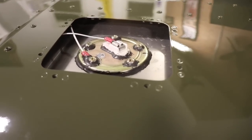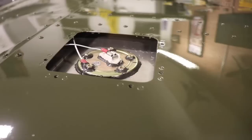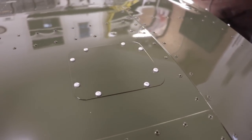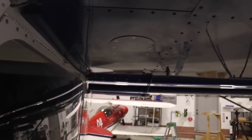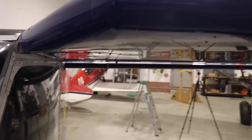Now in the Super Duty, you can see that the fuel senders do sit below the skin. So all I need to do on the Super Duty is put a flat cover over the sender. If we take a look at the right wing, this is what the cover looks like over the fuel sender. Now you might wonder what's the point in mounting the fuel sender on the top of the fuel tank, as opposed to the factory location which is on the side of the tank. Let's just say someday you notice fuel dripping from the bottom of the wing.